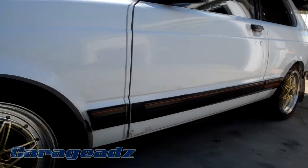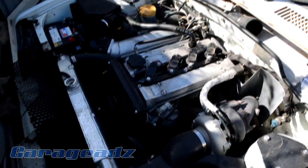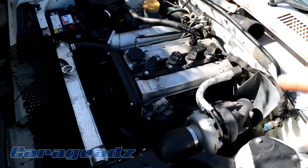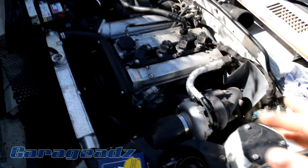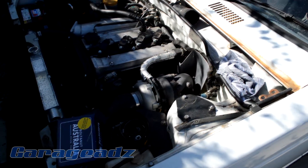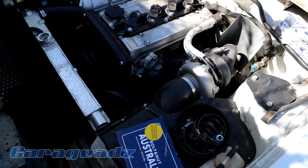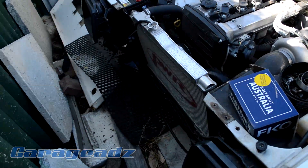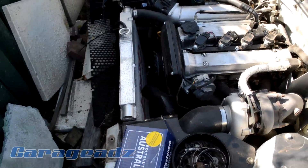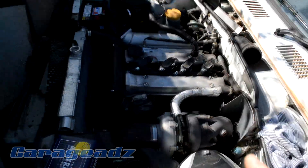It's pretty terrorizing, this thing. The engine is a built 4AG motor running a small port head, coils on there. It's running Eagle Rods, Ross Pistons. The turbo is a GTX 2867R — it's a very, very modern turbo, it's a fantastic turbo. Running a PWR AE86 radiator. Running HKS 264 by 8.35 cams.